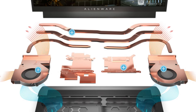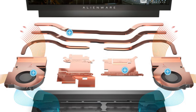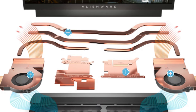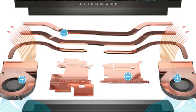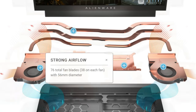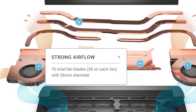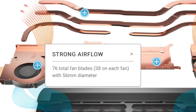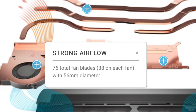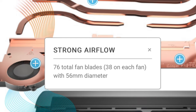Next, let's talk about the thermal management system, which is how the Alienware M15 R6 dissipates heat to prevent its internal components from being overcooked. Dell names this the Alienware Cryo-Tech Cooling Technology, which has four unique cooling features. First of all, the M15 R6 has a dual fan design with 38 blades per fan, for a total of 76 blades in a 56mm diameter. These two fans pull in cool air from the top and bottom vents and push the hot exhaust air out from the left, right, and back vents for optimal cooling of the core components.